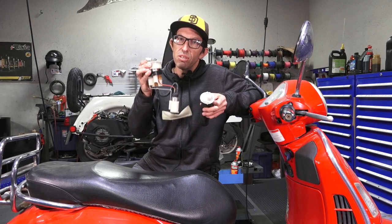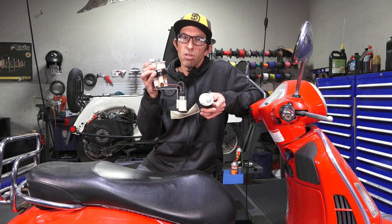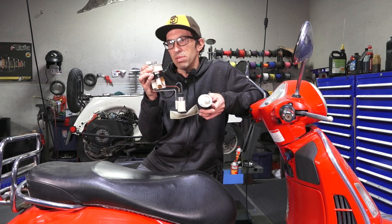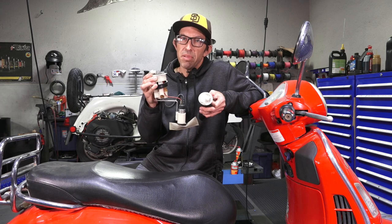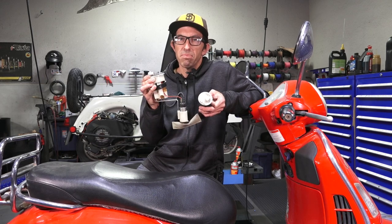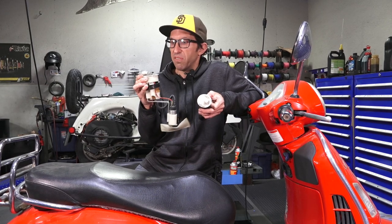The fuel pumps are specific to fuel-injected scooters. Very reliable fuel pumps for the most part. There is a small range of Vespa scooters made between 2009 and 2011 that do have a recall on the pump. You can call your local dealer, give them the VIN number, and see if there's a recall. If it's not in the recall, the pump just failed because it's old or it sat too long and gummed up.